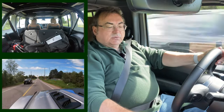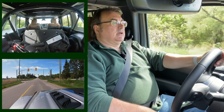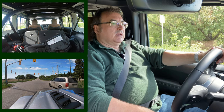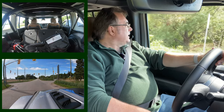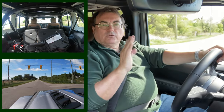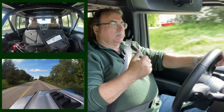As an EV, there is a manual switch here to put in maximum regen. It will almost take you to a stop — it won't hold you; there's no hold feature — but depending on how fast you're going, it slows you down. I would say it's like a level two setting out of four for regen, so it's kind of in the middle. Letting off the accelerator and reapplying, you can see it's not super dramatic.